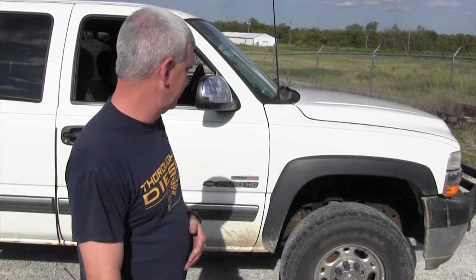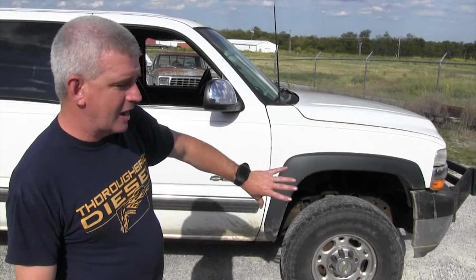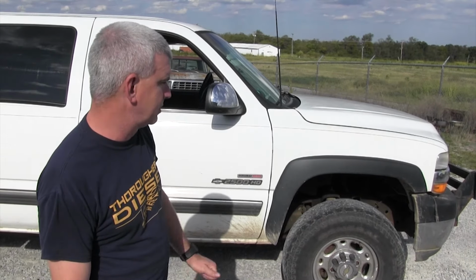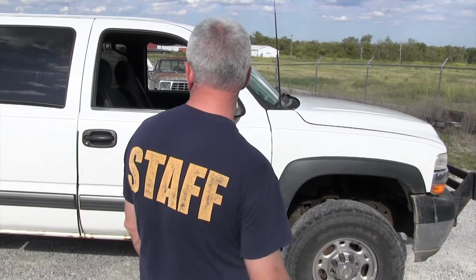You do a four-wheel drive boosted launch on this out on Saturday night trying to show off in front of your buddies, you're going to screw some stuff up. So don't do that. We all know that, we've seen those pictures. Center link on the trucks needs to be addressed as well. If you're using it in a competitive application, make sure you take care of that, and all those upgraded products we have on our website as well. Front hubs on the Duramaxes were not the best. I've had to put a couple of hubs on this truck as well. I think you'll find if you have these, you may have a hub problem with it. You know, pretty easy on change out. You buy the hub as a full assembly and away you go.